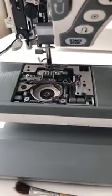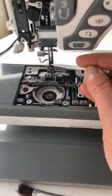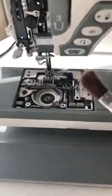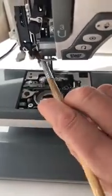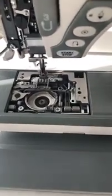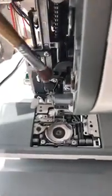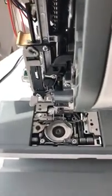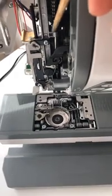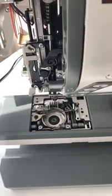Okay, can you see round here the needle post? Here you get an awful lot of fluff that goes upwards. So it's not just about fluff going downwards, the fluff goes upwards, and you need to clean this off here and hoover as you go. So I don't want to disturb any more fluff until I put my hoover on. Okay, so inside here as well, I would get my hoover in there and gather up any fluff that you find. And anywhere where you can see, so here look particularly, where the needle post is moving through this joint here where there's metal against metal, I'd give it a little tiny dab of oil just to help smooth it through.